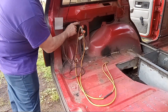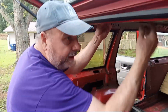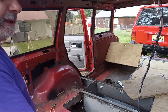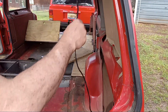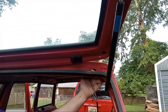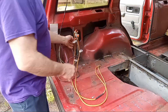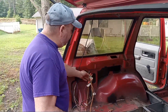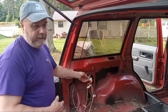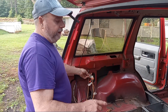My ground wire off of one of these ties in right here. This wire loom is from my rear, just like the original was — running right here across. I'm going to take this inside these columns, just like the original, and feed it over in there. From this hole here up over, I'll be feeding to my original tag light. By utilizing the ground, that leaves me with the other five: a taillight that runs front and rear, brakes for the rear only, reverse for the rear only, and turn signals for all the way around.